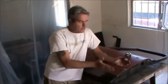So normally when you're grinding this, you just grind it to where the two pieces split, and that's generally far enough, but you of course have to try fit. Now, the reason we're going to all this trouble of getting this up to 12 inches is not only to line up the door at the bottom, but also so that we get a good proper weld here. When we're butting these two pieces up together, we don't want to do an overlap like this because that tends to harbor moisture and you get problems coming back anyway. The additional gap is more bodywork than Bondo that you're going to have to do.